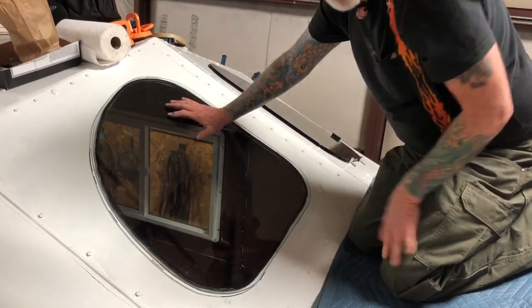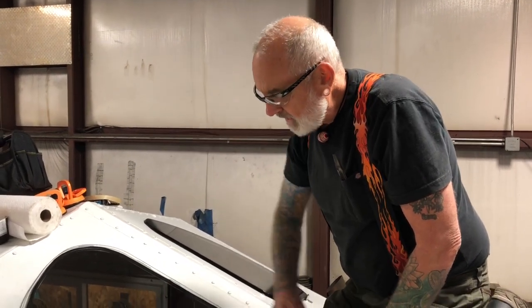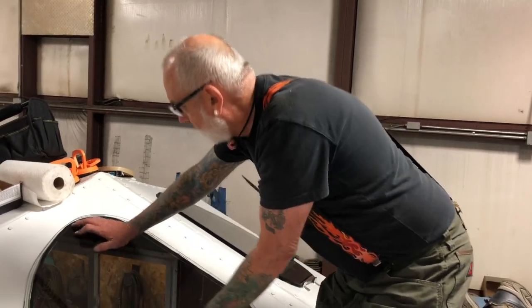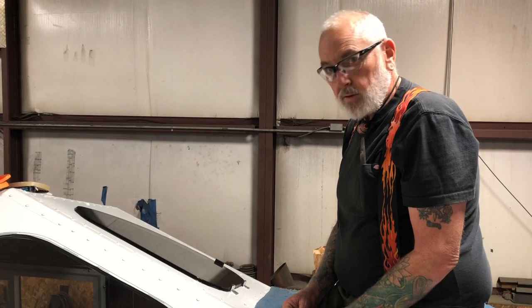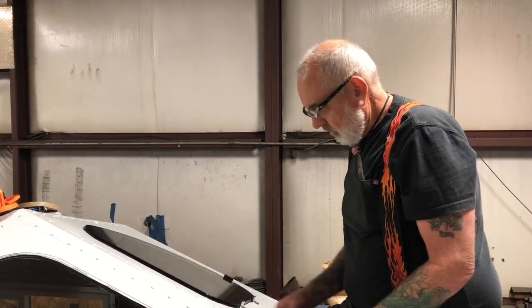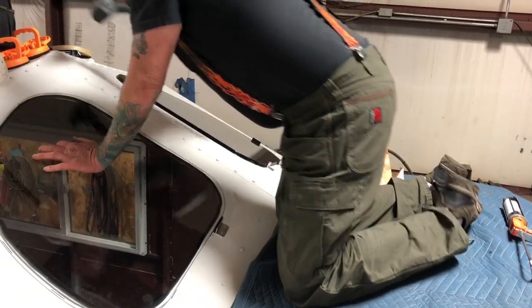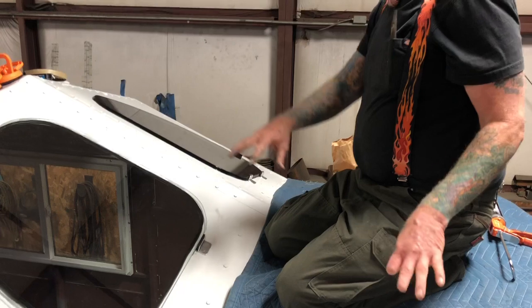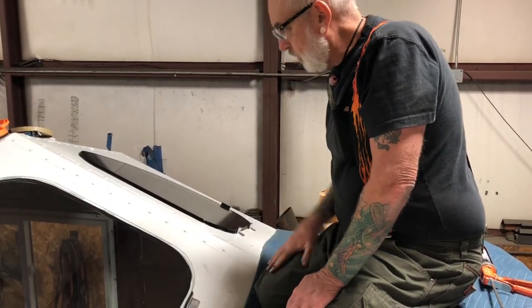So, these are laminated safety glass like a car windshield. So if these get hit with a rock or something, they'll crack, but they won't fly into your face. This is like backwards of a windshield install, because I'm putting the setting blocks in after I pushed them into the glue. The butyl tape will not hold them. When they get hot in the sun, they'll try to slide down. That's why I put the setting blocks on there. Smart. With the rubber block.